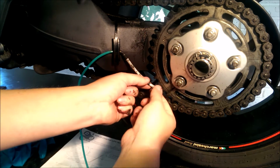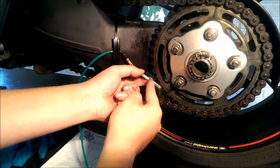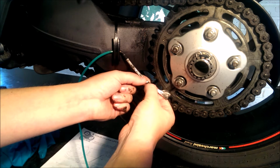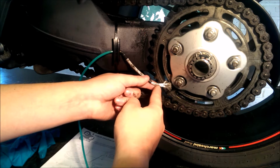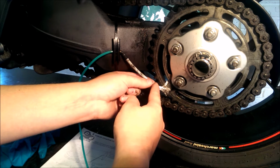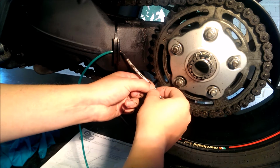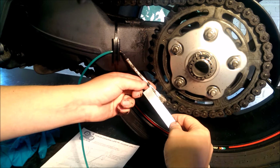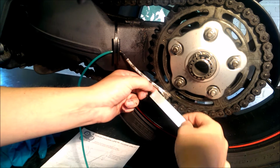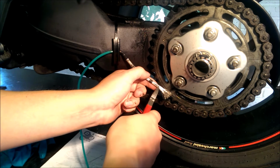So I've pulled this up. This is now the black collar on the end of the tube. Okay, so what we're going to do is cut 12mm from the end of the tube and just feather the end as well. So again, just measure 12mm away, or thereabouts, and then we're just going to cut that off.